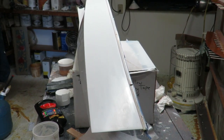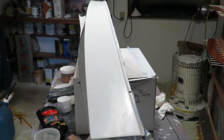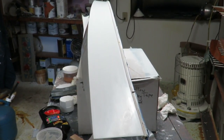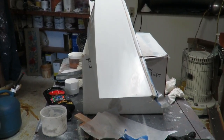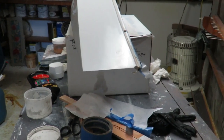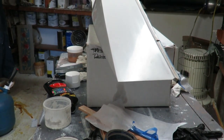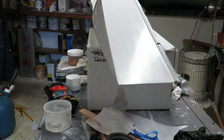Onto the fine cut cleaner and then the swirl remover, and I'll show you the results of those two steps. But I think you can see that glimmer, the gleam. I haven't wiped this off totally, but you do want to wipe off the grit from each stage, because otherwise when you're doing the next stage, you're really not doing a finer grit if there's a lot of grit left over. But you can see that it's starting to have quite a bit of reflection there. You can see the fluorescent light reflected in it from above.